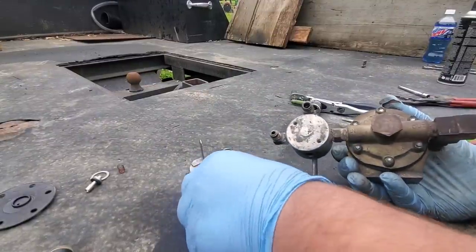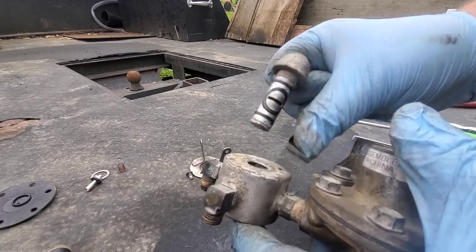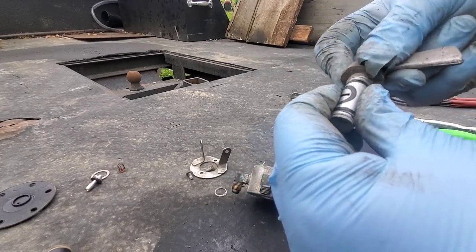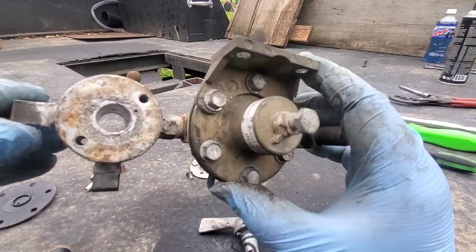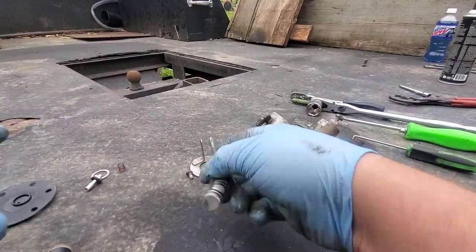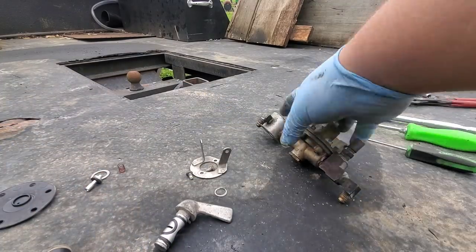Now, on to the air valve here. It's got a spiral lock — I just dropped it right here. It's got a spiral lock that holds on this back side, and then a plate and two screws on the front. Now that that's out, it just pulls out of there. This thing is leaking bad in all these O-rings — they're just flat. The aluminum is almost sticking up proud of them. You're going to want to look down inside the bore. There's a little bit of dirt from my glove right there. You want that to be clean, but make sure that there's not any terrible gouging in it. I can see some lines in it, but it looks like that's all from grease. What we're going to do is get some brake clean and a rag and get this all cleaned out before it goes back in. These O-rings are just trashed on here.